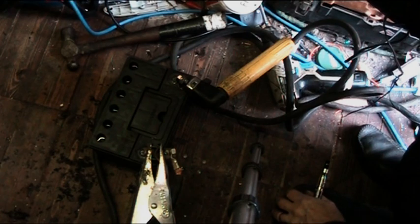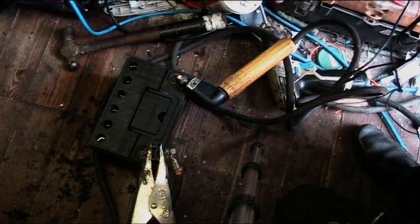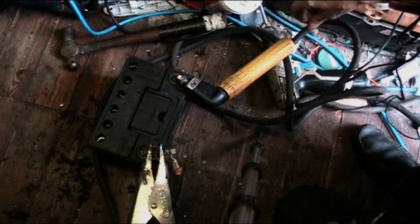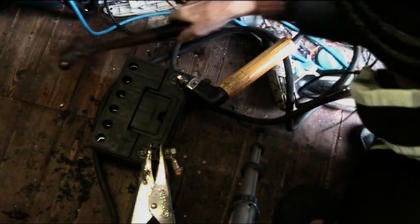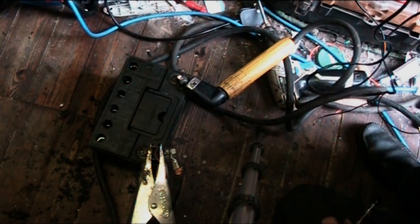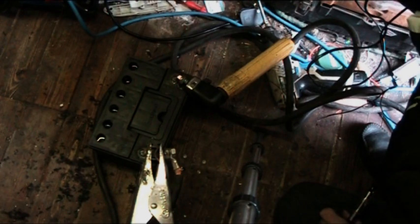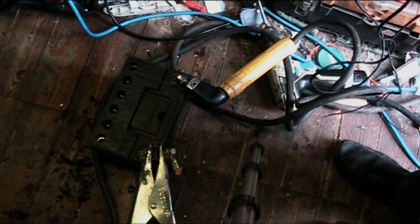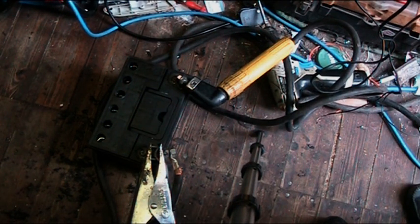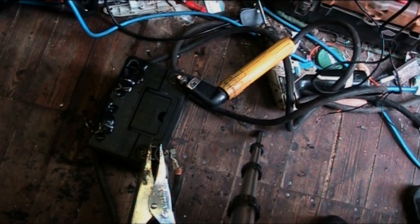So, make sure you've got no naked lights, you don't have any cigarettes on or anything like that. Make sure you've got goggles on to protect your eyes. Now it's going to start bubbling out of here quite fiercely. As I say, 3 minutes is probably long enough. I'm going to start it off at 5 amps and then turn it up to 50 amps. That shouldn't take long to kick in. Here we go. You can see how violently that's come up. That's okay, it's overflowing, it's not going to hurt.